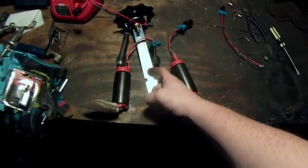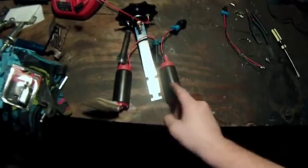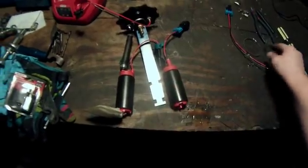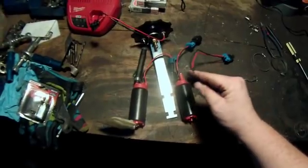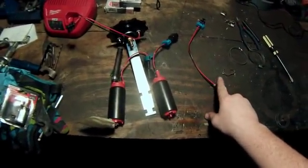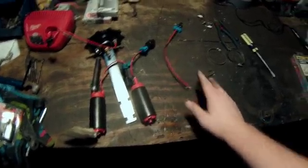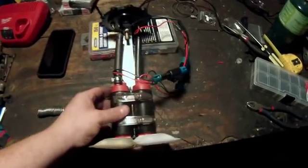I've had it sitting for a while so I figured I'd finally add it on. What I'm going to do is weld a piece in the center - since this is steel - and weld a piece coming off the bottom to act as stops, then wrap them with the same type of hose clamps that were used to hold it originally. I also have to butt connect one of these plugs in for this fuel pump and run them off the same positive since I have a really heavy cable run for the fuel pump. I'm going to solder them too because I'm not big on just butt splicing.